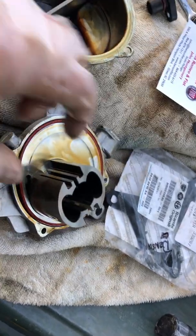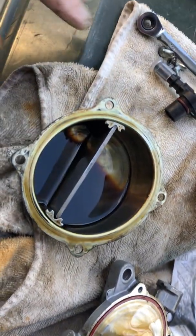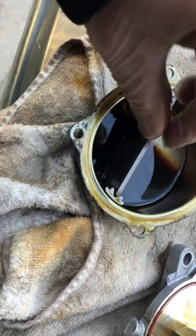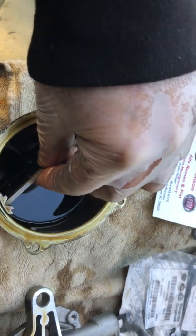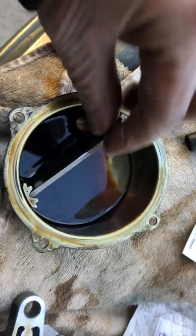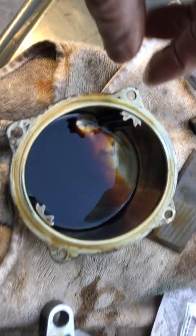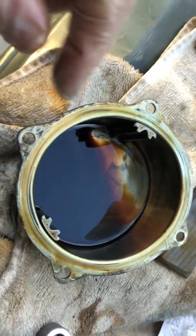Look at the back side of this. It has a little drive, and this little slot drives this. Notice that the vacuum assembly is actually oval in shape. So as this moves — this goes on top and basically fits right over here like this. As this thing turns, this thing just slides. It's like a little slider. There are no gears, nothing like that — just a big thick metal plate. This is the plate, and this is the piece that it rides on. It just slides and goes round and round, and that's what develops the vacuum.